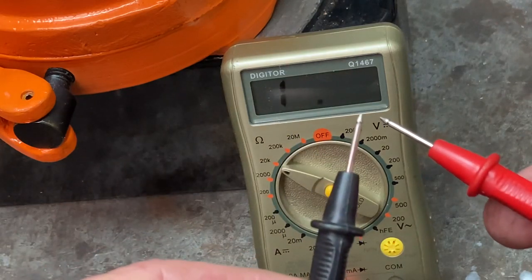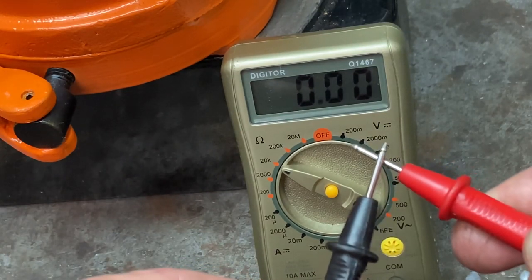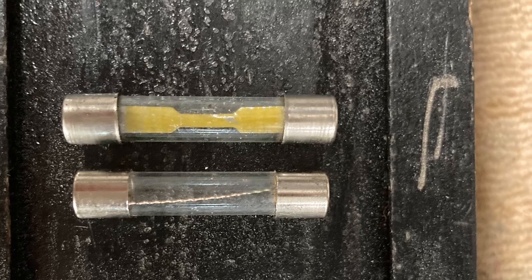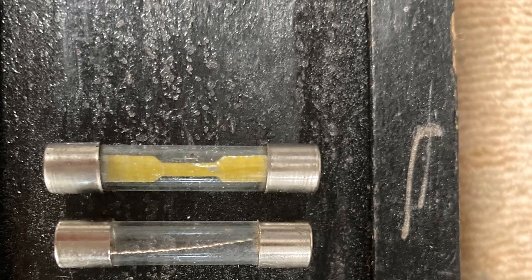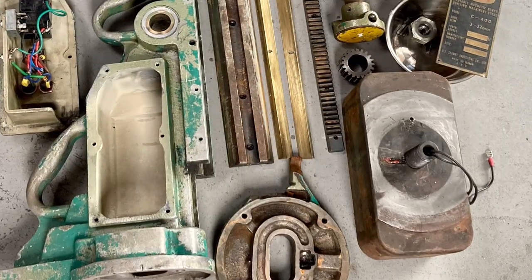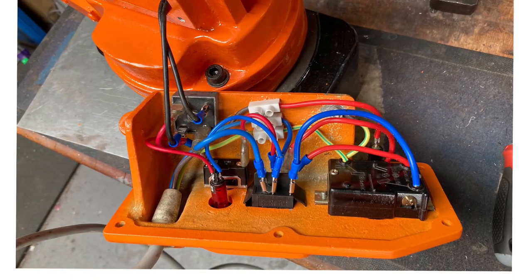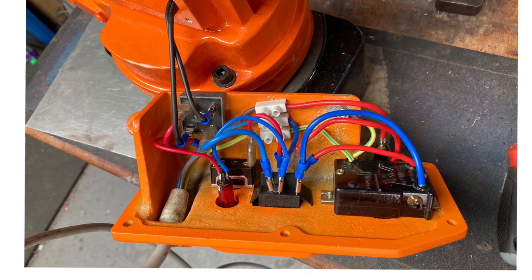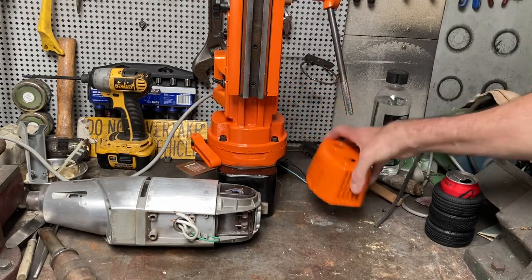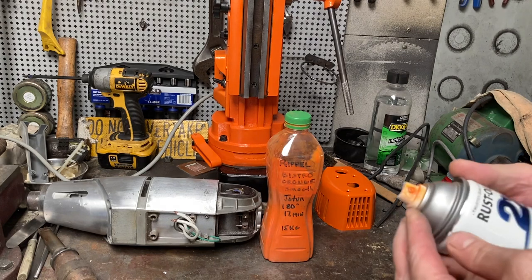A reading of one means the wire is broken inside and not touching, and a zero means there's a dead short — so you want an ohms reading in between those two. I also replaced the 30-amp 12-volt fuse on top with a more appropriate 250-volt 15-amp fuse on the bottom. From here it was a case of strip it all down, sandblast, powder coat, and rewire it — I probably should have filmed this. Here's a quick shot of the replaced wiring and new switchgear. The orange I'd powder coated the base with happens to be the same colour as Rust-Oleum real orange — I didn't want to pull the whole drill apart just to powder coat it, so I settled for paint instead. Pretty happy with the results — they're a very close match.